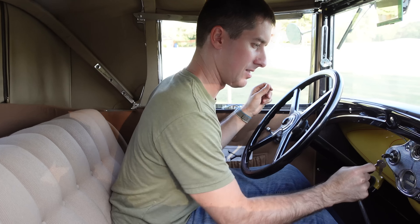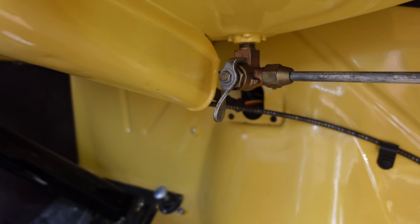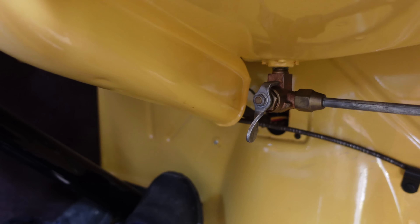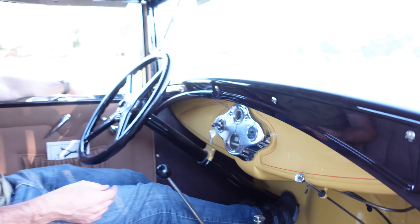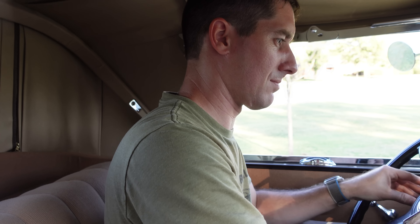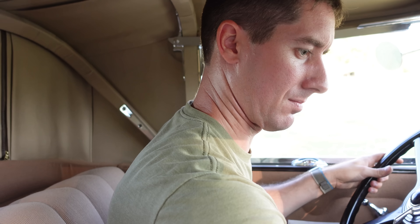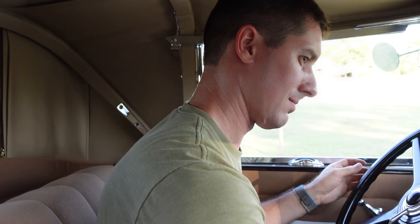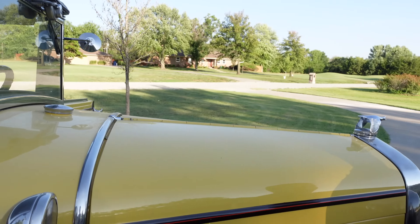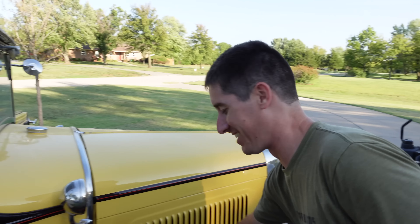What's the sequence of events here? Neutral, clutch, step on the starter. This is the choke, and the handbrake. That's the starter down there. We were trying this earlier and it didn't do anything. This is the fuel shutoff. It cranks over. I think our little pull-start move where we pulled it in gear sucked some of that fuel in, because it started instantly.